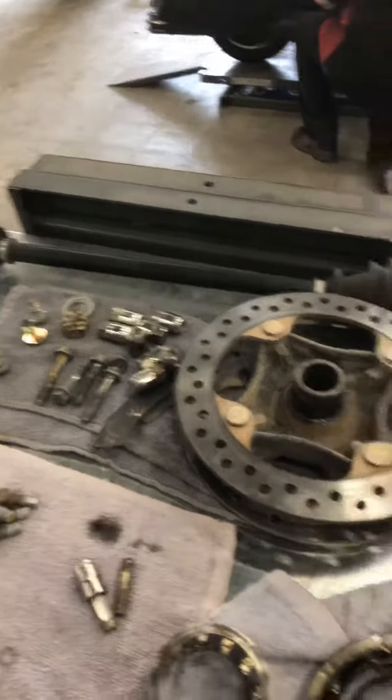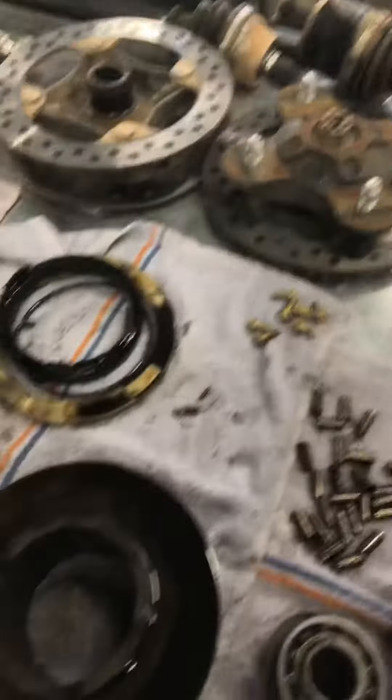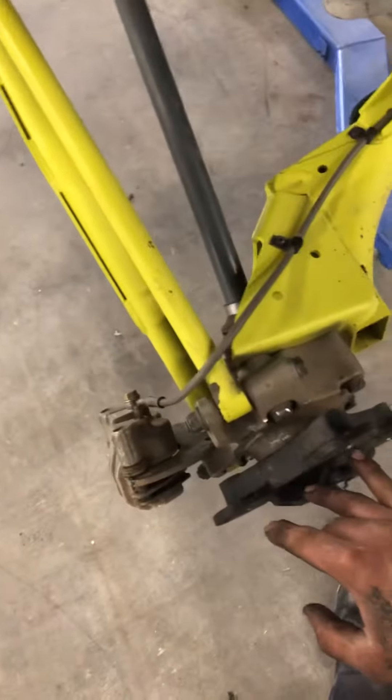This one is actually bent — when it was on the unit and we were running it, you could see the axle was bouncing around, so it was bent. So you'll need to put two new front axles on this. I also got a parts list together for your rear wheel here. It looks like one of your studs probably just backed out. There's nothing wrong with the tranny — it just goes through all the gears, spins freely, everything's perfect. It looks like one of your studs just backed out and got caught on one of these bolts, and that's what locked up this rear tire and destroyed all this.